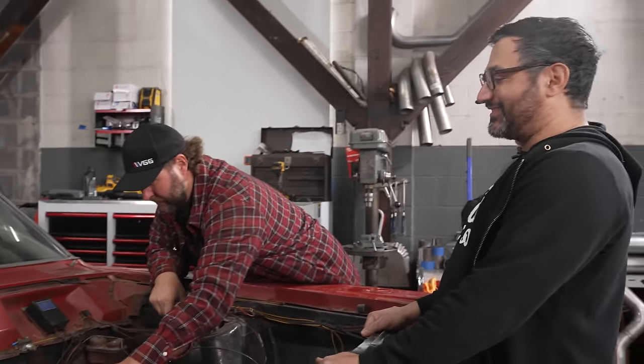So we got an aluminum radiator that's gonna go in here, a cold case unit, and it's not quite vehicle specific for this model. We have to do some slight modifications. We wanna bring it farther back so we can get the digital fan in. Tried slightly modifying this with some professional fab tools and it's still kind of in the way, so I'm gonna just snip this out and then the rad isn't gonna rub on this and put 48 holes in it on my 900 mile drive home day after tomorrow. Wow, it's day after tomorrow. Okay. Do you have any more grinder wheels?